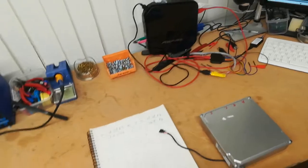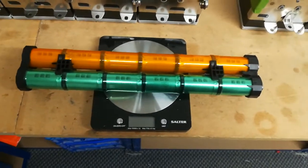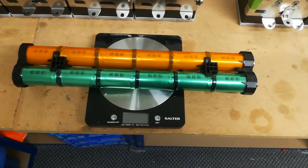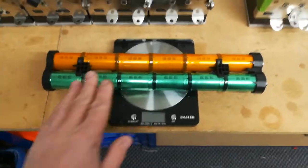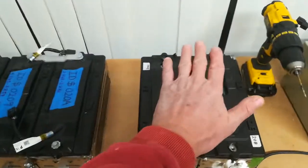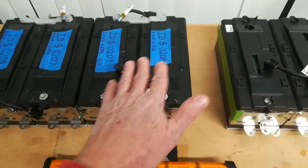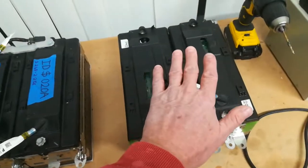Let's have a quick look at the LTO cells and some weights. The standard OEM double sticks weigh 2.35 kilograms each, and one LTO block weighs 14.5 kilograms. There are seven of these in the OEM pack, so the pack is essentially equal to one of these LTO blocks. So the penalty for going to lithium with LTO will be 14.5 kilos in the back - basically doubling up. The removal of the OEM cells accounts for one of these blocks.